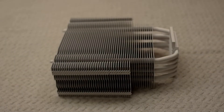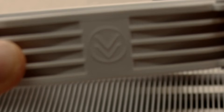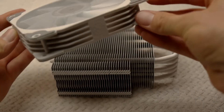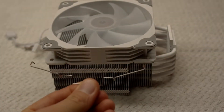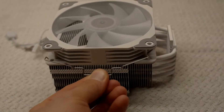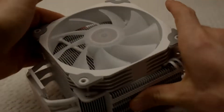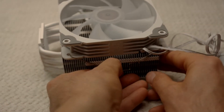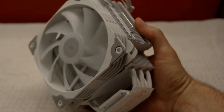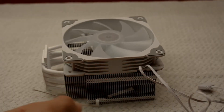Next, we have to install the fan to the heat sink. The fan has arrows pointing in the direction of airflow, so be sure to install it the way you want the air to be blowing. Simply position the fan where you want it on the heat sink and use the supplied spring clips to clamp it down, then do the same for the other side. You don't need to remove the heat sink from the computer to do this — it's just easier to demo this way. Once installed, it holds together very well, and removal is easy too — just pop off the clips and the fan can be removed.